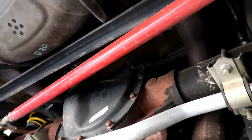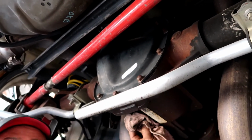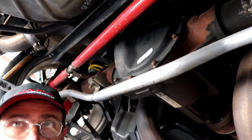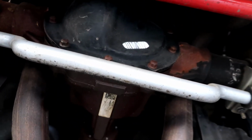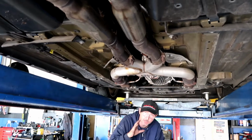Yeah, I'll have to get that taken care of when I get back. If they make a gasket, a gasket's great. Clean it up nice and shiny and just use a gasket. But if they don't, then you clean it up and just use the silicone. But you don't put both. What happens is the silicone doesn't spread out perfect on it. It'll create a ridge, yeah. There's a little lump somewhere and that's all it needs to find its way out.